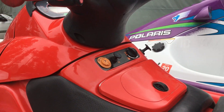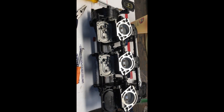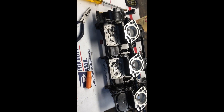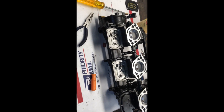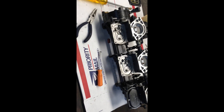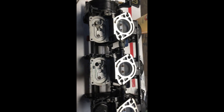So here's what I found and what I did to fix it. Typically when you have a situation like this, the first thing you're going to look at is the needle and seat. But usually when the needle and seat leaks, you also get popping and flooding while the engine is running and idling. In this case it idles perfect, it runs perfect — the only time it does it is overnight.